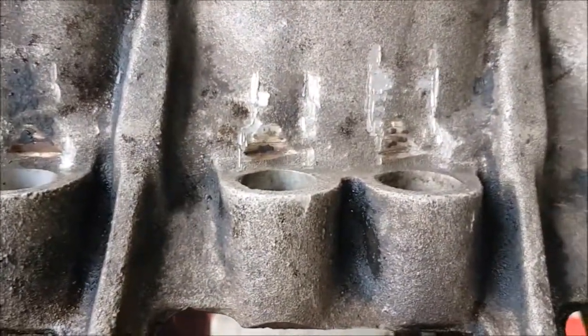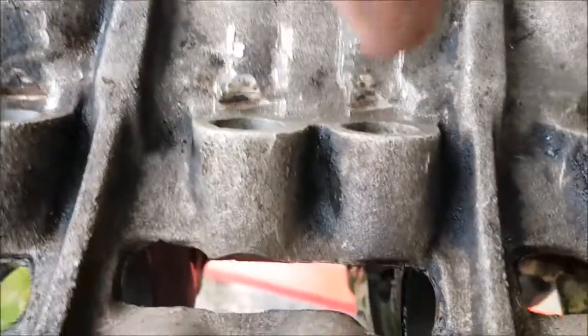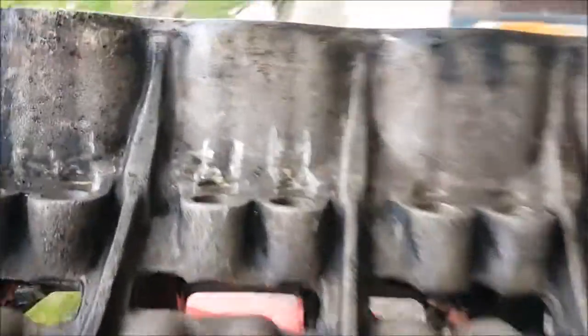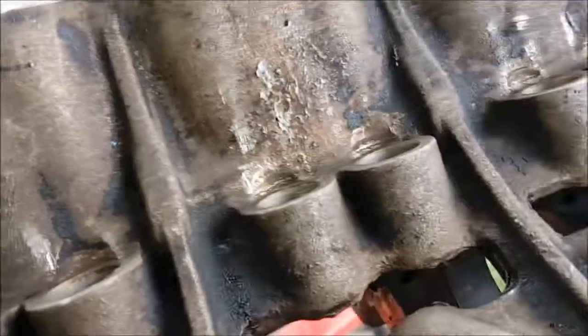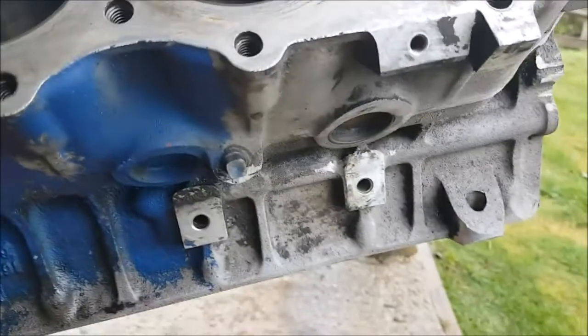Unusual marks - looks like someone's had some fun getting the hydraulic tappets out. Hydraulic tappets go in these holes here, and the push rods go up those channels to the cylinder head which goes in the top. Someone's had some fun there - I didn't notice these before I cleaned all of the black death out of the valley. And again over here, there's something amusing going on. I'm not quite sure, but I think this engine's been pretty badly abused to be honest.